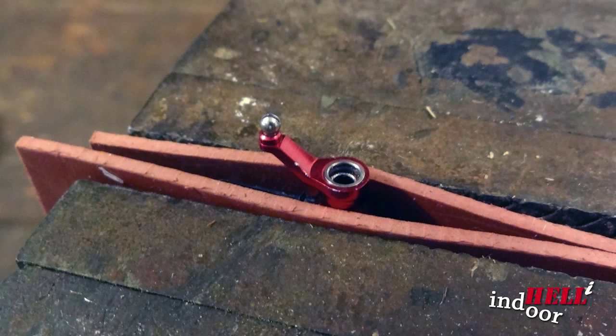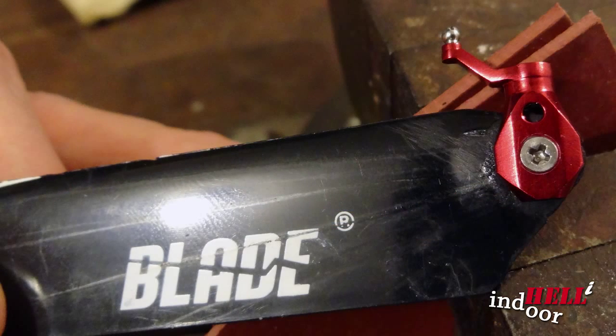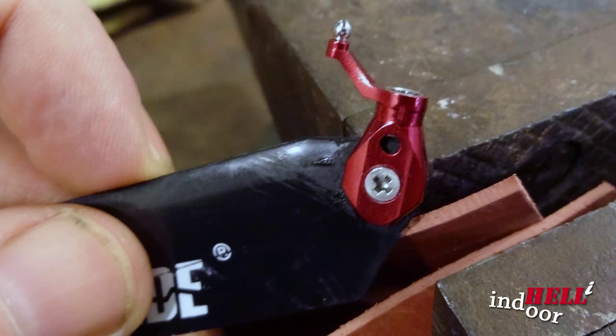I eventually decided to put the grip in a vise so that I could use some heavier tools to try to pop that race out of there. I placed the blade back on the grip so that when I tightened the vise down, it would not pinch and close up the gap on the grip. So be careful not to bend it all up if you attempt this.